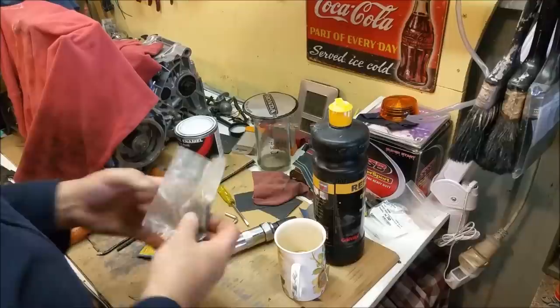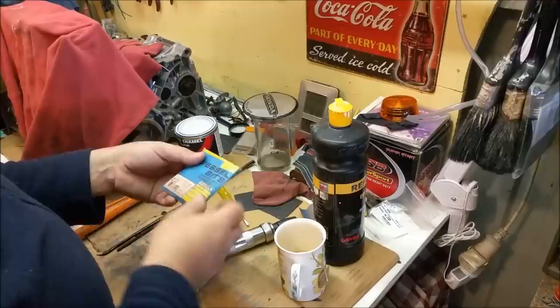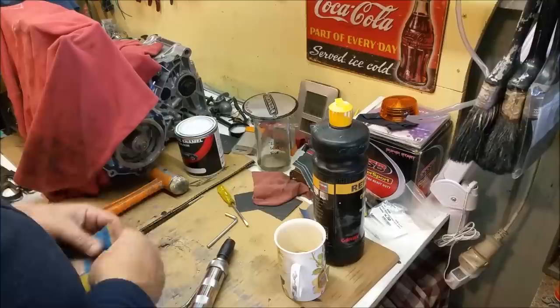What always bangs on about these? These are impact bits for Japanese Industrial Standard. Apparently JIS stuff finished up, or they stopped producing it in 2008. I'm about to order some hand screwdrivers in it though, because I keep pulling these out, but they're so good. They're actually a much better fastener than Phillips. The inside's a sharp transition, not like a Phillips, which is rounded in the centre and tends to cam out.